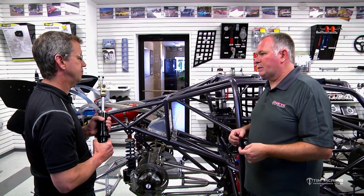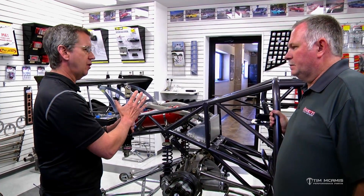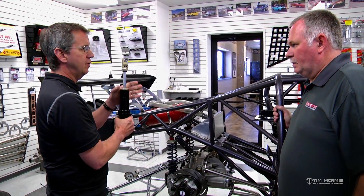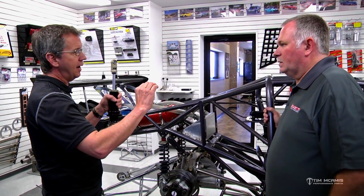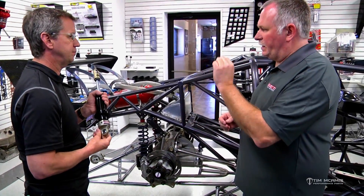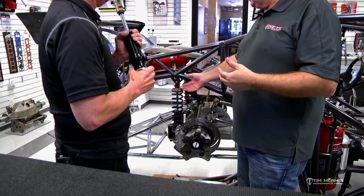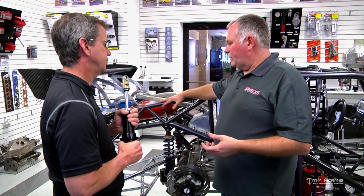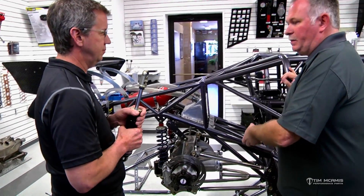We can put that much more bite into it with shock adjustments. So once I do that adjustment — by tightening the extension and softening the compression — when you initially look at the shock wrap, you're going to get a slight bit of extension, then it's going to go into compression, then it's going to roll back trying to get back to ride height. When it compresses the back of the car and we soften that, it's going to compress more. Let's say it compressed 400 thousandths; now we soften it up a couple clicks, that makes 450 to 475 thousandths. So it drives the back of the car down. Anytime it drives the back of the car down and the car is lower in relation to the axle centerline, it adds weight back there. At the same time, it lowers the intersect on the car because it drives the four-link bars down — a lower bar has more bite than a higher bar.